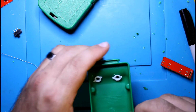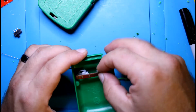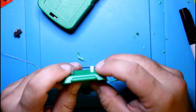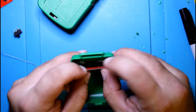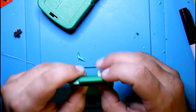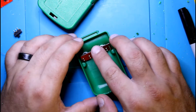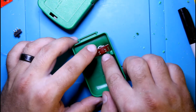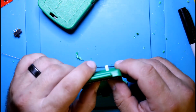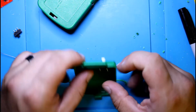These you can trim, of course. So that sits pretty much like that. You push the button, it pushes down. Pretty good. So after we get the wires soldered on there, you want to put the board more or less like this. Gonna have to hot glue it. It's at an angle, as you can see. You want to make sure this is flush up against there, so these buttons have some bounce and stay firm.